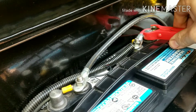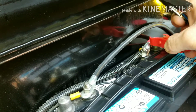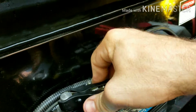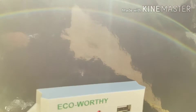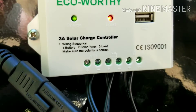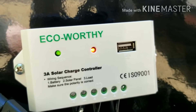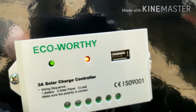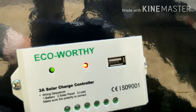If you remember, on the back side of the panel we have the positive and negative held in by two screws and soldered on, so we'll heat that solder up, remove them, and attach the new ones. Now that the wires are reinstalled, let's prep the surface, add the tape, and attach the panel. Once that's installed, you just go ahead and hook the charge controller up to the batteries. There's a good look at the charge controller, and that is how you set up a solar panel on a dump trailer — or pretty much any other trailer or anything you want to hook up. As always, thanks for watching — ATS Outdoors.